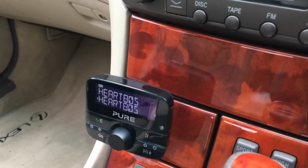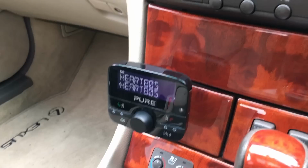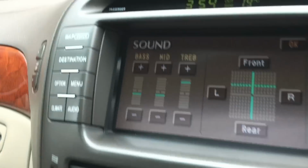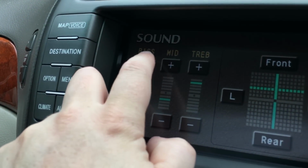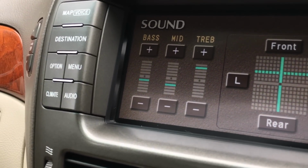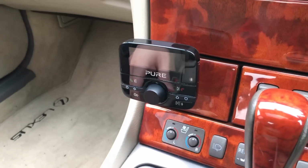It depends on the area you're in. If you've not got a very good reception, it can sort of dull the tones on your music. So what I'm having to do is actually push my treble right up, and in most cases I'm having to drop my mid-range right off as well, and that's simply so that I can get the music to sound better. But other than that, I love this system. It's really, really good. It's modernised my car completely.